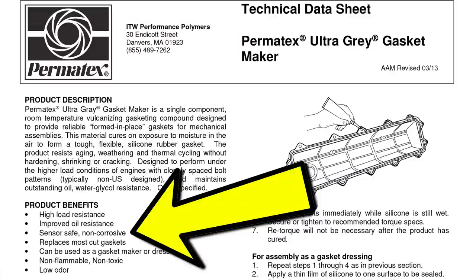This includes when you're resealing your cam covers, rocker covers, front engine cover, timing chain cover, intake gaskets — anything of that nature. If you don't use sensor-safe silicone RTV, you can very easily kill your oxygen sensors, as they are susceptible to the compounds in these sealers. When a sensor dies from silicone poisoning, you'll normally see a white powdery substance and a whitish color on the tip of the sensor.